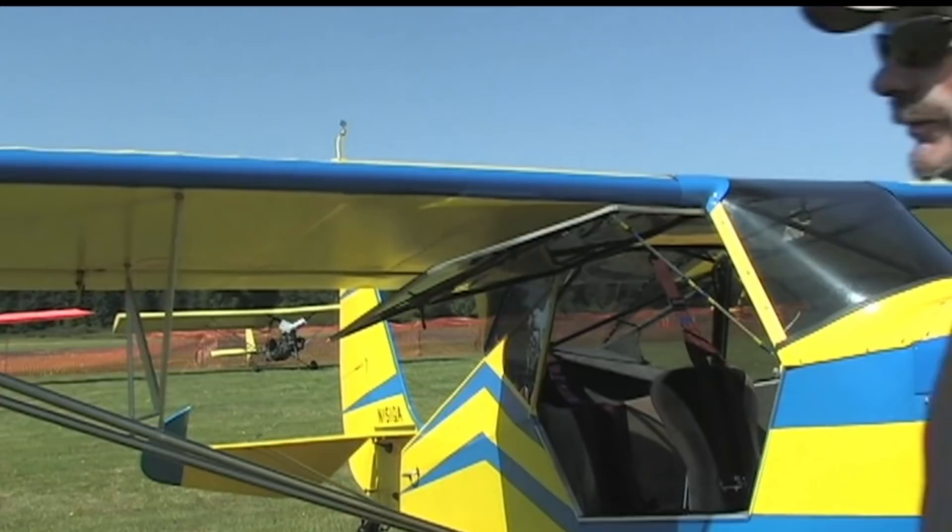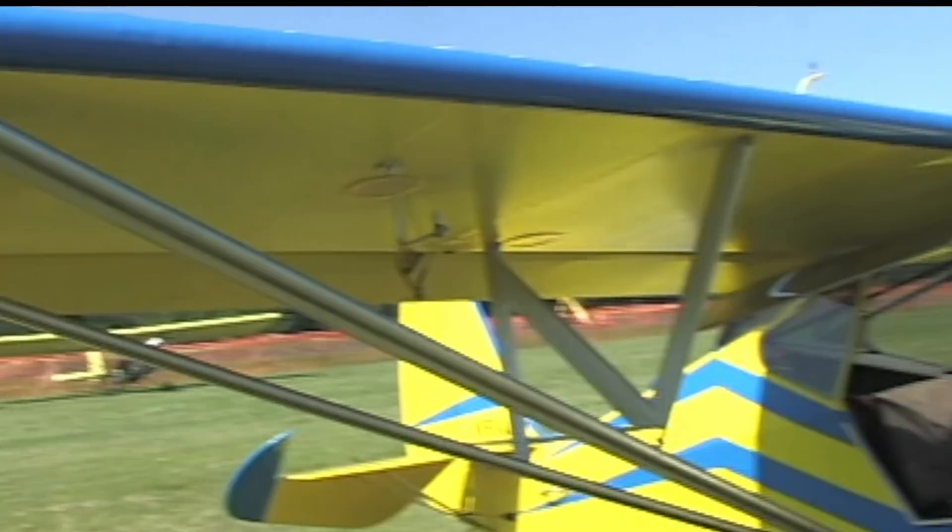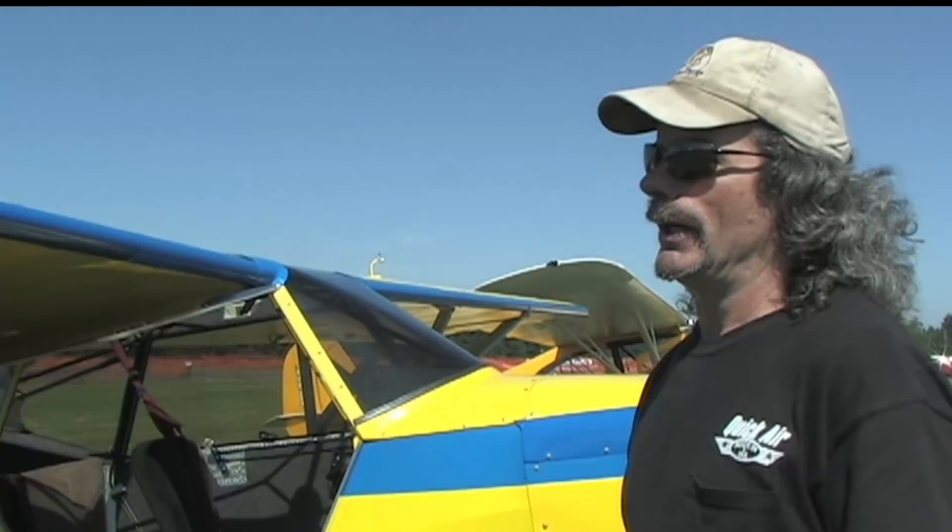I've stopped within 100 feet and been off within 100 feet. The control system is a standard stick and rudder type of control — that's exactly what I stayed with. One thing I did is I made a longer flap, you can see it here — I made a bigger flap in the unit. I shortened the ailerons a little bit, kind of copied Greg Miller's configuration, and the flap does its job for stall and slow flight.